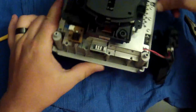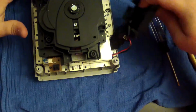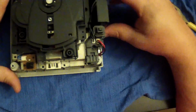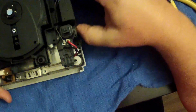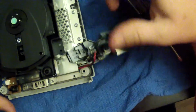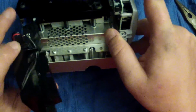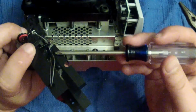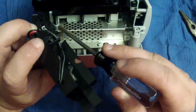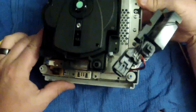not put the fan on actually, and this is why. If you go ahead and position your fan, I'm going to show you, as you position your fan back on top of the shield here, sometimes it can be a bit of a booger because you have to fit it in just right. I'm going to show you at a kind of an odd angle. As you can see, this part of the fan right here where it's got the indentation has got to go right here on this little post. So the fan's going to be sitting on top of this shelf and on top of these screws. But we're not going to put that on just yet, and I'm going to show you why.